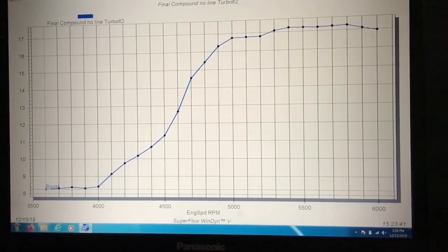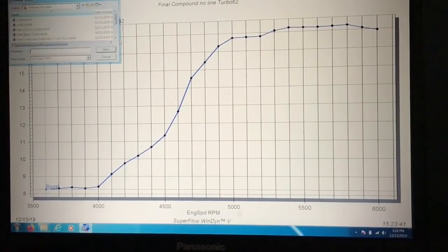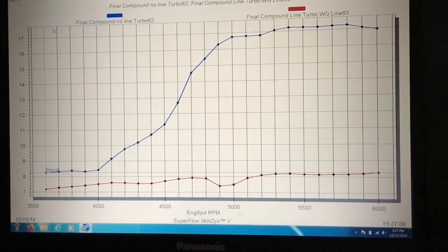Let me show you what it looks like when we added the line back to the wastegate. With 7-pound springs in all the wastegates, we had about 7 pounds of boost, and that works out good. The only problem is that back pressure helped save me but was also working against us — we tried to turn the boost up by installing a manual wastegate controller on the small turbo and an electronic controller on the wastegate between the big turbo and the small turbo. That electronic controller was a three-port, meaning it had reference lines both to the top and the bottom of the gate. But even with that, we didn't have much control and couldn't turn the boost up much more.